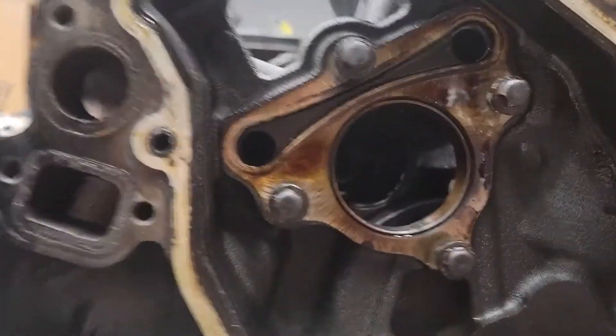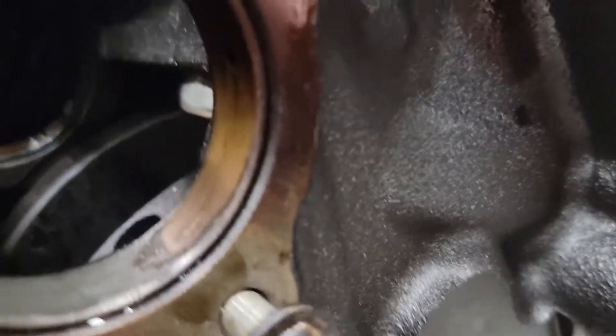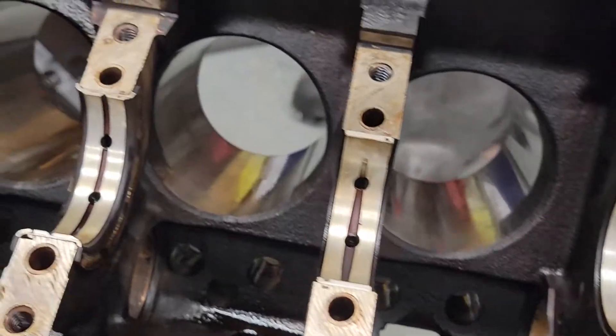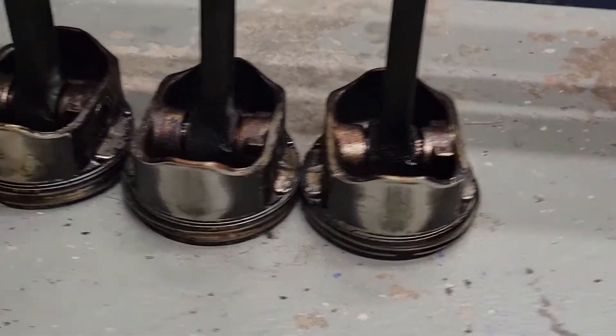The camshaft has been giving me a hell of a time trying to get out. After I get it out, I start looking at the bearing — I might have been better off just buying a fresh block and starting from scratch. Got the motor completely torn apart now and I'm a little concerned with the wear. The side skirts are hitting a lot, and looking at the pistons, every single one all the way down shows significant wear.